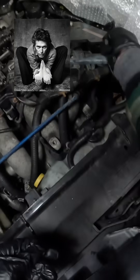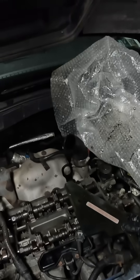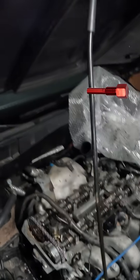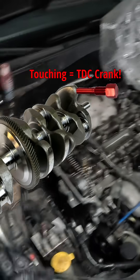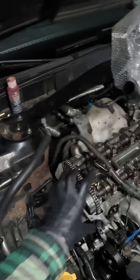You have to use this plate in the back of the camshafts to lock it in center — top dead center. There's a little pin in the back. You can set the crank to top dead center as well, and then you can just tighten everything down.